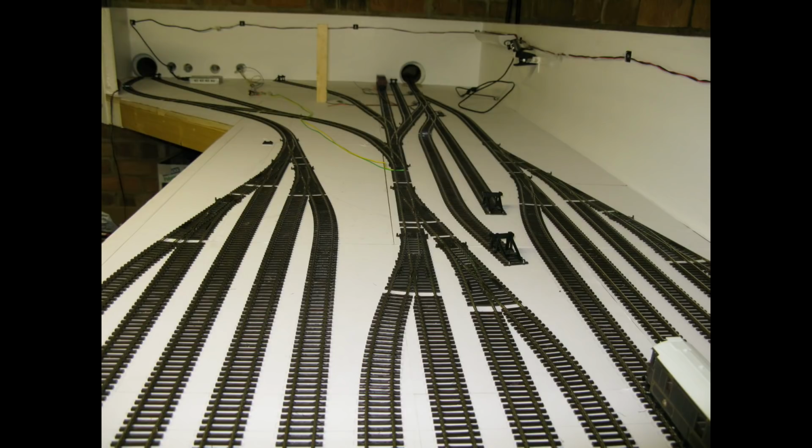I also tried network cameras and they were just as bad. Now maybe if you've got a very fast PC and a very fast network, you'd get away with network cameras. But the PC I was using at the time was a 100 meg network. I now use gigabit network, but it was 100 meg, and I had one network camera on it and it was still too slow. And I pointed this out many times, and I still see people using cameras that are not real time, network or USB. I don't know how they get on, because they never come back and say I was doing this and this failed.